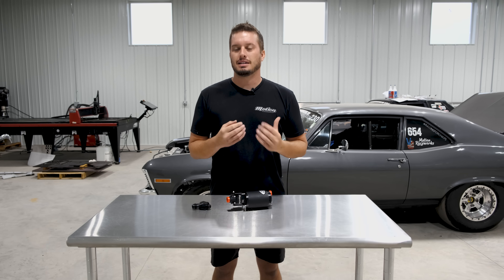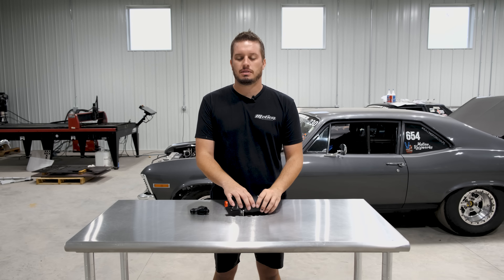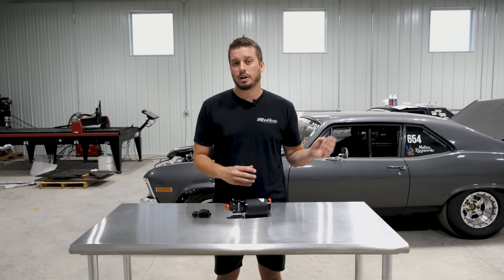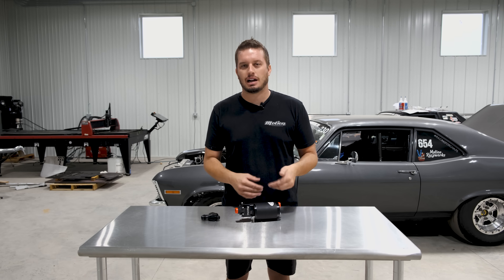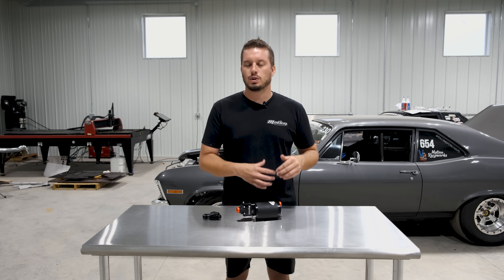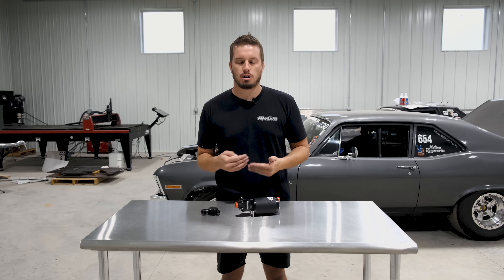The last thing you want to consider is the power feed. If you have a dual relay for the Magnafuel 4303, as it's directed to have, remember: if you're going to add a second pump, you need a second dual relay and you need to run the wiring properly. Simply branching it out is not going to do it. It needed all that amperage for just one pump, so a second one is going to need double that amperage. Underpowering a pump is going to burn a pump up as well, and that can be costly.